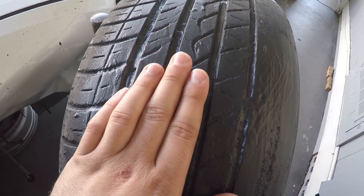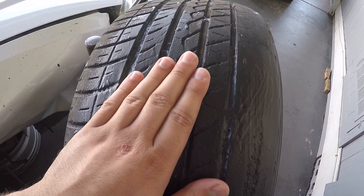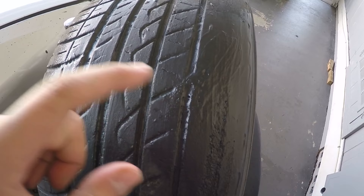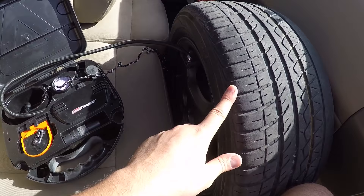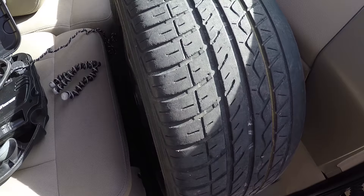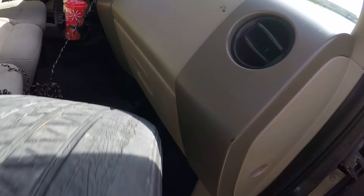I don't have an actual air compressor, so I'm going to use a small emergency air pump to inflate the tire. After we air it up, we're going to see if these patches are holding up, then spray with soapy water and check for bubbles. I have the pump hooked up right here. It's at 20 PSI — and you can actually hear the leak.